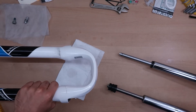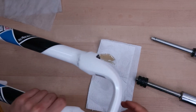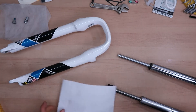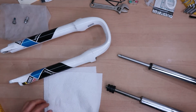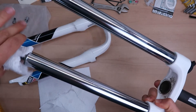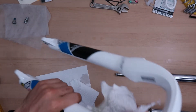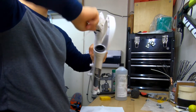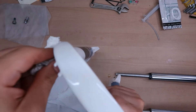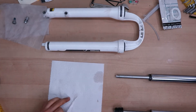Okay, so there was some oil and this oil actually looks in decent condition — so definitely these forks have not been used much. Now I'm gonna use a few more paper towels just to clean everything down with alcohol. Oh look at this shiny surface! Let's see how our seals are here — the seals look in decent shape. We can just put some grease inside and that is gonna be enough for this fork. I think we are quite lucky so far.